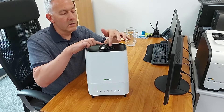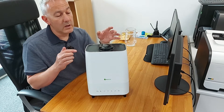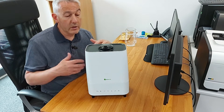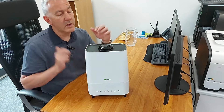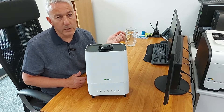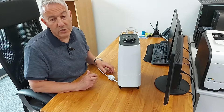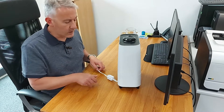To finish things off we've got the lid which matches the feet. On the top of the lid we've got directional nozzles — it's really useful to have this. If you've got a humidifier that only goes in one direction then you're going to get a lot more problems with condensation and puddles of water appearing on the surface. But by being able to divide the mist left and right, you get much better humidification for the room and fewer problems with puddles or condensation, which is a problem for all ultrasonic humidifiers when used in an environment with a temperature difference.